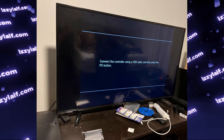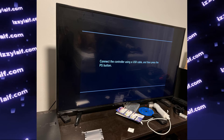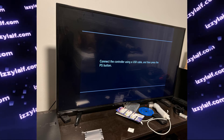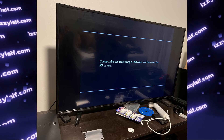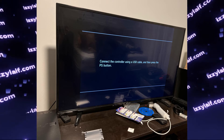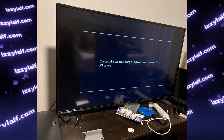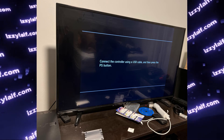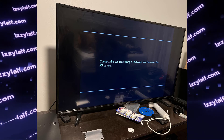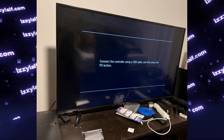They may be a little bit difficult to find. However, you don't need a perfectly working PlayStation 3 DualShock. PlayStation 3 controllers are known to have problems with sticks, but if you only need the controller to access this menu, you don't need working sticks. You only need the PS button and the D-pad, and maybe the symbol buttons as well — these are the only buttons that need to be working.